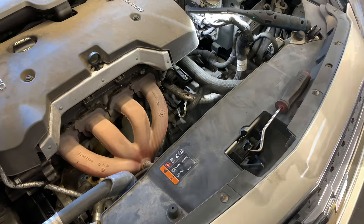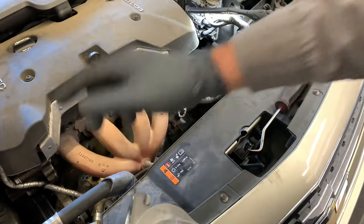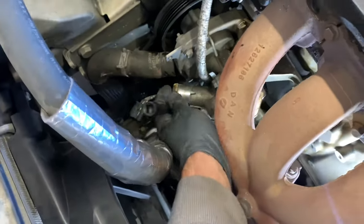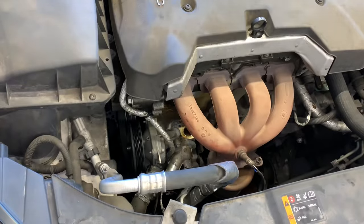A tip: if you have the new parts already, you can use them to locate where the bolts are. Use the new part to find the same bolt locations on the old part and remove them. It takes a 13-millimeter socket with a medium-deep socket and about a four-inch extension. If you look through the exhaust right here you can actually see the bolts, so at an angle you can see what you're doing.